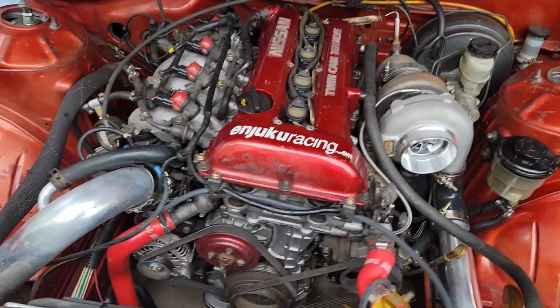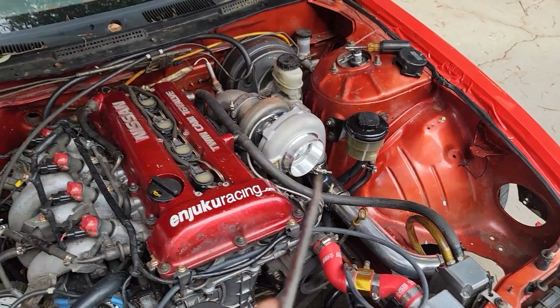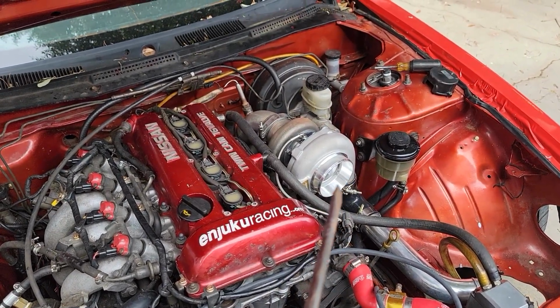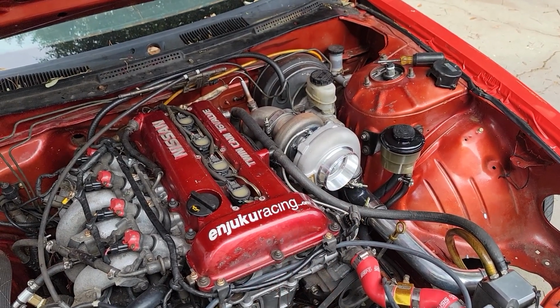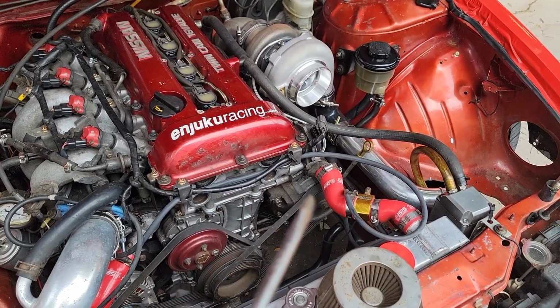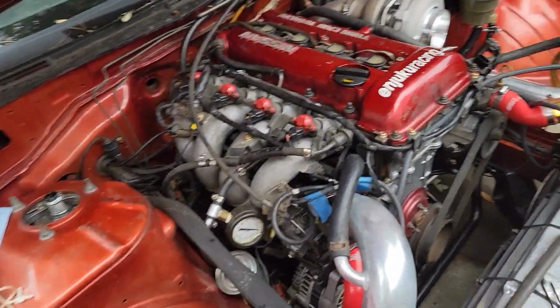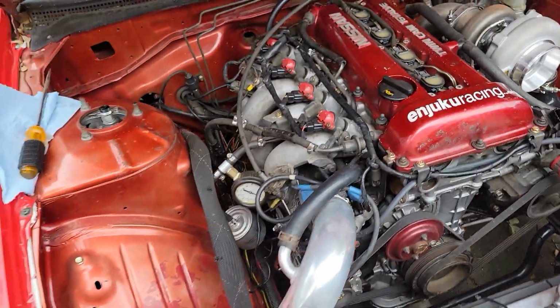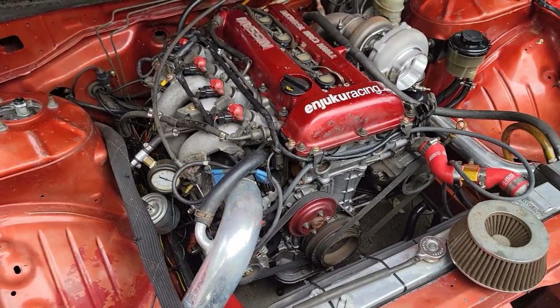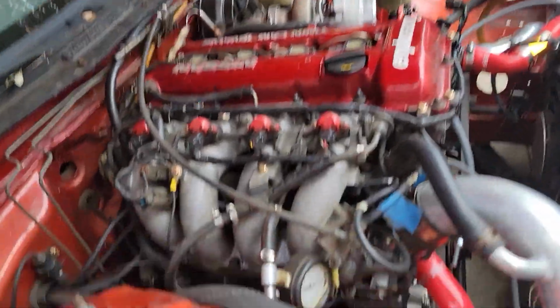First thing, it's already verified that this ran with the mass airflow plugged in there. On the last video, I had it too close to the turbo and it was breaking up at idle, which is to be expected, too much turbulence. I put a pipe out and it idled perfectly. Everything was good. So I know I'm starting with a good running car, and it's idling fine on the Enthalpy tune. I just want this Megasquirt to be able to tune it myself for all this new craziness I did.